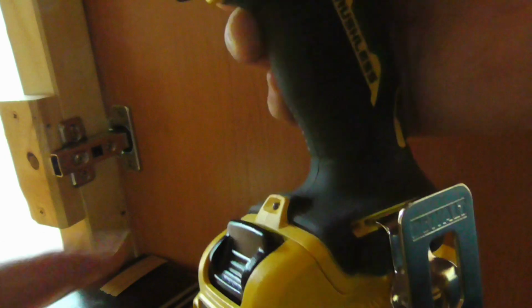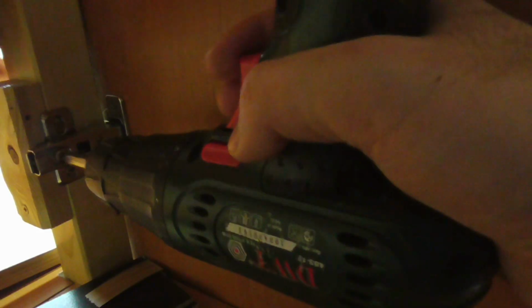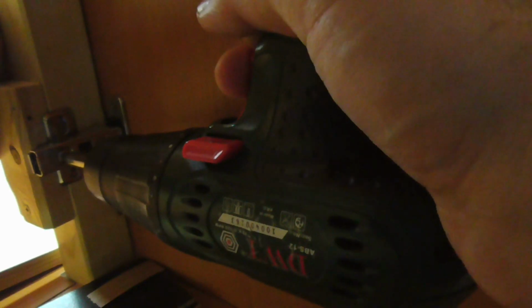The LED of this one turned off. We have a gap here that can be adjusted from this screw. This is at a much smaller angle. This is at a bit larger angle. Now we can open it. The top portion is way too close, while there's gap on the lower side. So let's increase the gap here. Now there is no noise.